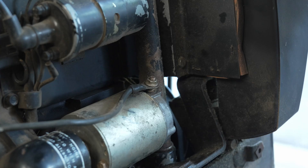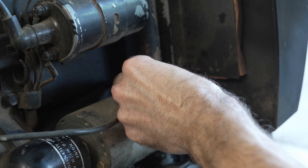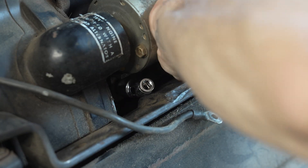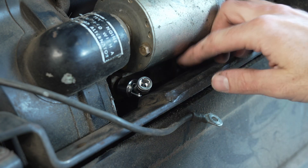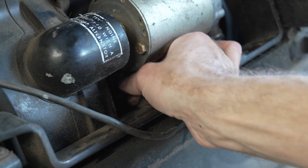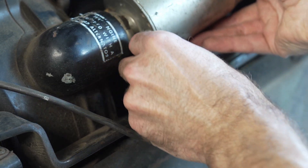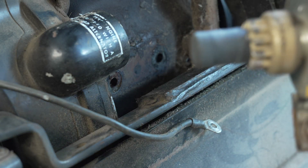Of course we need to remove the cable also, and that's a 7/16ths. Obviously you can do this before you loosen up the starter. Then we can just let that drop and finish taking the mounting bolts out. Just be careful to not turn the nut out too far with the socket on there or else you'll get your socket stuck. They come out pretty nice by hand once they're loose. Then you just got to find the right angle to get the starter out.